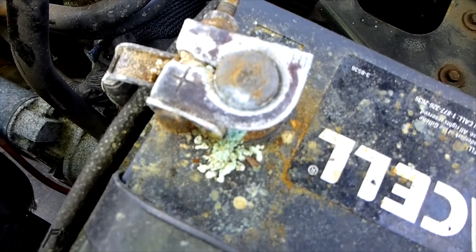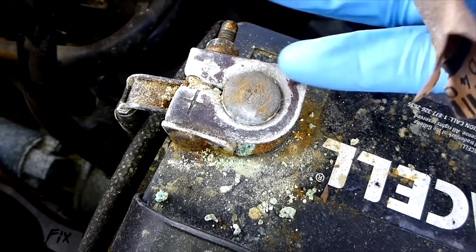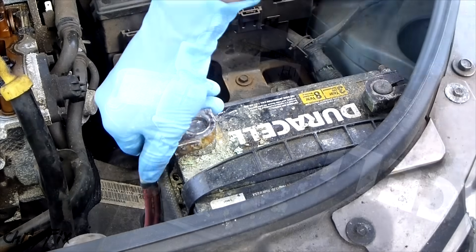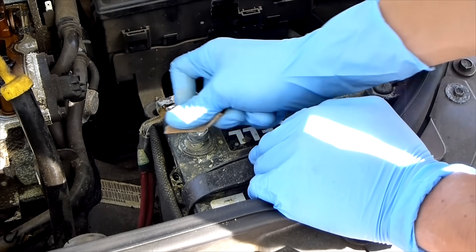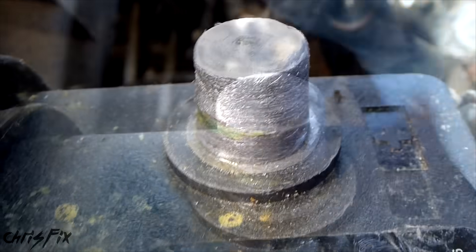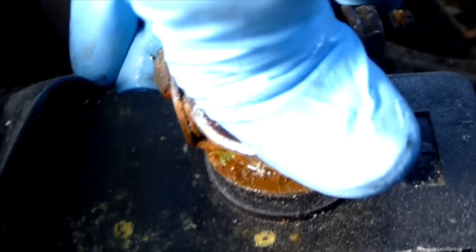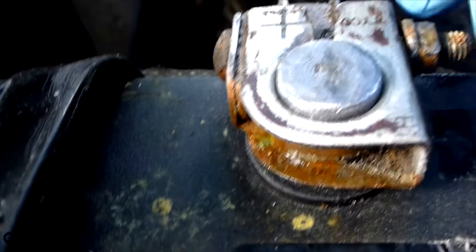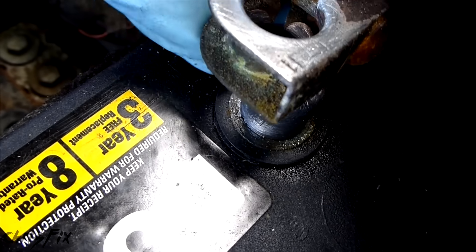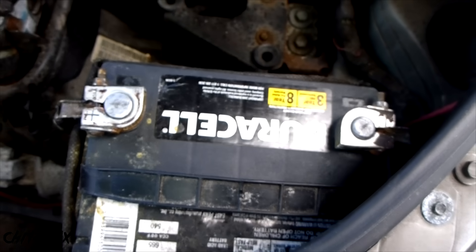Here's a good example of bad battery terminals. When that happens, you want to clean off your battery terminals really well. I have a piece of sandpaper, and that'll do the trick. Just loosen the terminal, get all the dirt out, and sand the post down. You can see I cleaned the post off pretty well and the inside of the terminal too, so they attach properly. Slide it back on and tighten completely with a ratchet. Both battery terminals are done — that looks good. Now we'll tighten them up and take a reading.